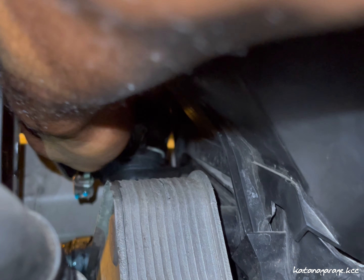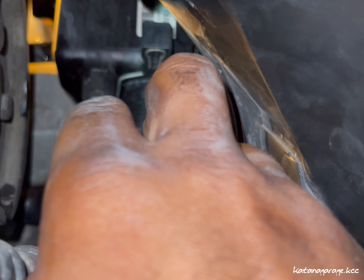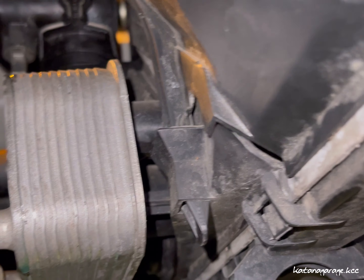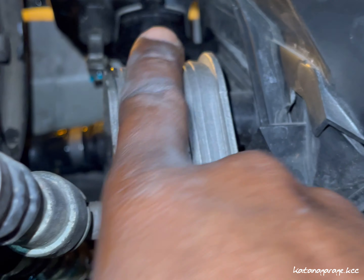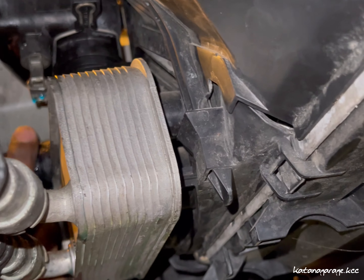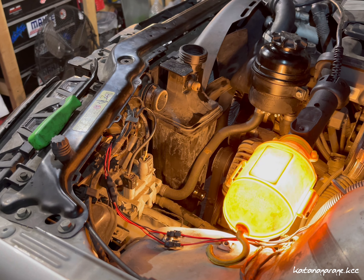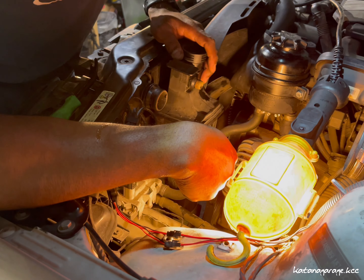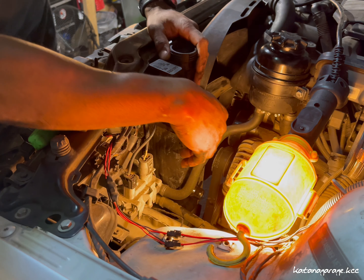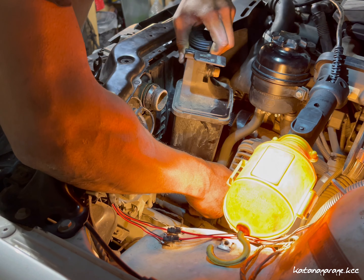From this side of the vehicle, all you've got to do is just slide the latch that way towards the middle of the car — towards yourself — and that will release the reservoir from the radiator. We already got the sensor disconnected. Let's go ahead and pull it up — just wiggle on it and it will pull right up. Make sure you've got a spill bucket under there, then just lean it forward and work it out of the way.